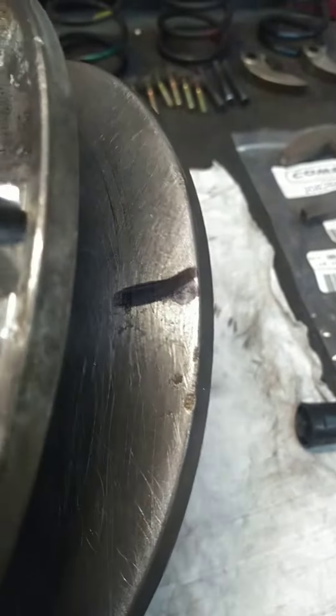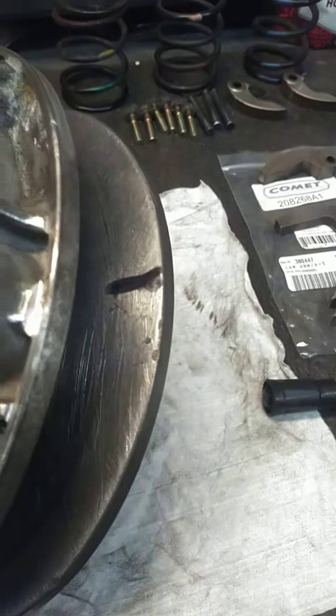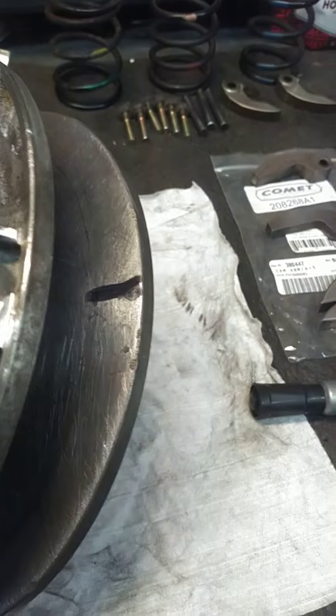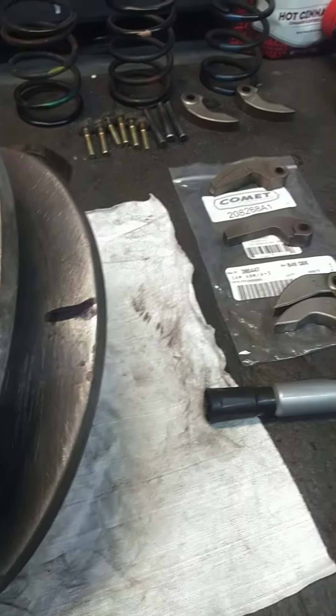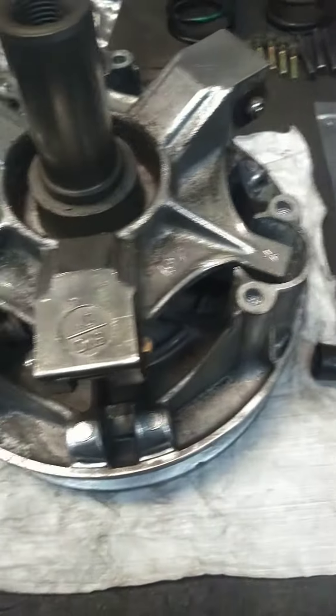Hope this helps. Another little tip: when you get that totally cleaned — which I haven't — mark it. That tells you if you've made it to a one-to-one ratio. You can run them all the way up. If you're looking for just a little more RPM, they won't climb all the way, but it's very efficient to get to one-to-one. These are tiny little lightweight clutches.